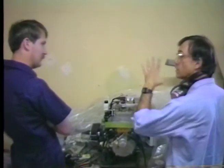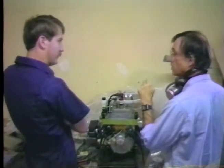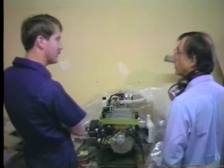So, and then there's something else I'm going to do to make it go faster. I'm assuming that also, I never have known whether I was limited by the prop or limited by the exhaust system on this engine. No matter what prop I've used on the airplane, it always turns up to 6,400. No matter what prop, including the little club prop, the little shortened prop that I... You think that would let it turn up even higher? If it was going to turn up, it would. Static? No, in the air. Well, I haven't really opened it up with that little club prop, so I don't know.